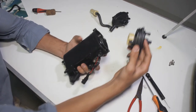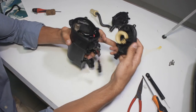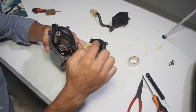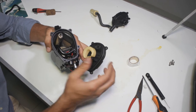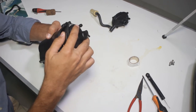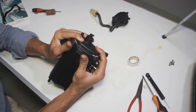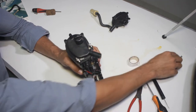You are now ready to reinstall the top cap on the fuel body. Make sure the little seal ring is present — it can be either on the stainless steel part or on the top cap; I prefer it inserted on the top cap already. Align the stainless steel cooling hose to the seal here, then press it gently until it closes completely. Now take the four Torx screws and reinsert them into the holes and tighten them back.